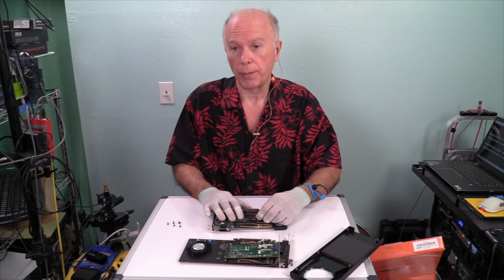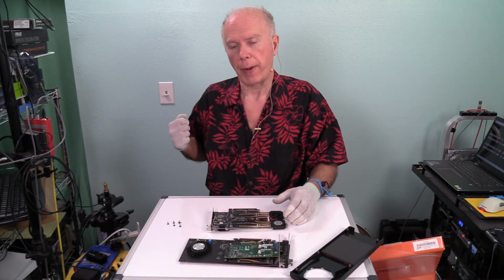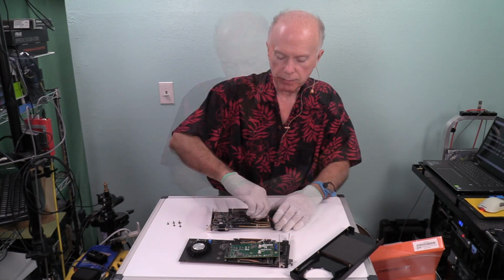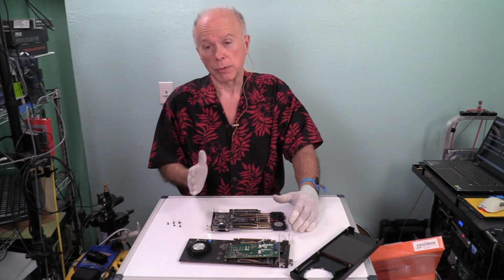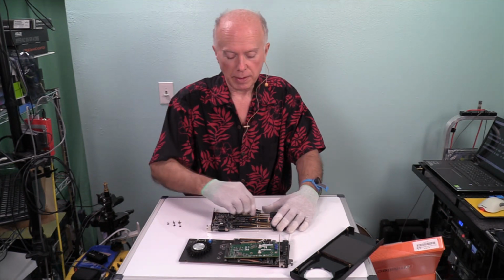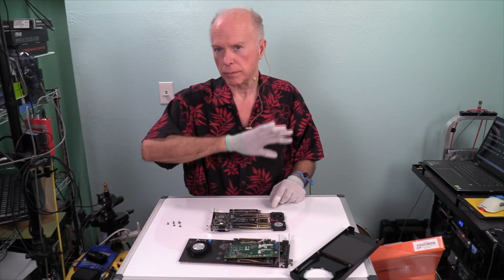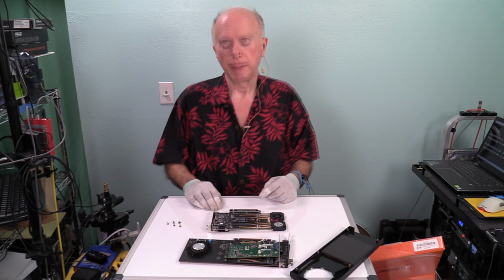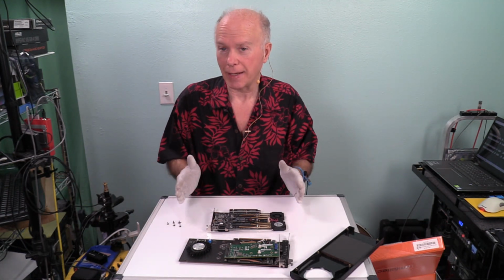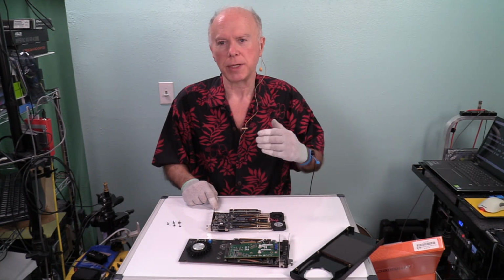But we went the full course, the full Monty, just like doing a BIOS update. We shut the machine down, powered off, pulled power, drained power, put power back to it, brought it back up. Performance was restored. Otherwise, on that quad card, it was the same problem that was talked about on the, I believe it was the X570 chipset, where if you had the WD Black SN850, which can be two ways, to the CPU, was not necessary for the firmware, or through the chipset, on the quad adapter, which on the Gigabyte TRX40 Designare is on a PCI Express dedicated 16-lane slot to the CPU, exhibited the same behavior as if it was on the X570 chipset through the chipset.